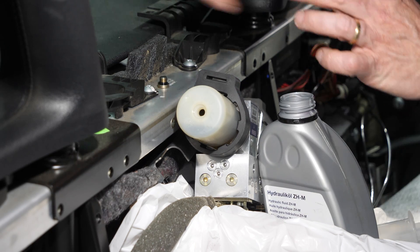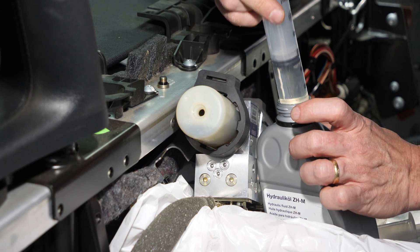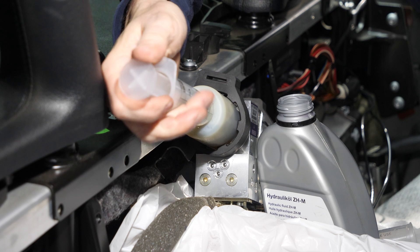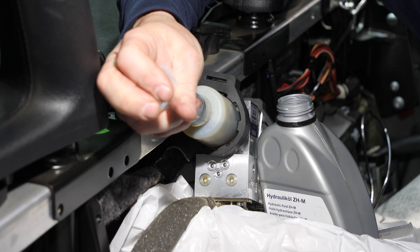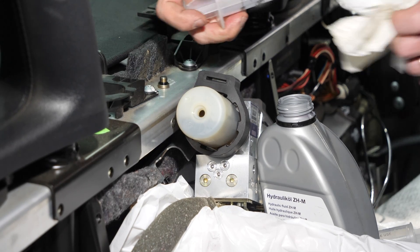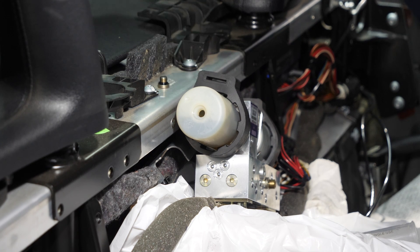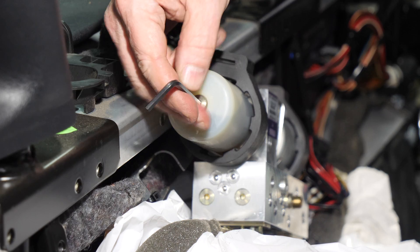I'll stick my syringe into the bottle and suck in some fluid. It's not going to take a whole lot here, so I'm fine with an ounce or so. I start squirting it in — my guess is that I need to fill this to about the level of the bottom of the bolt, and at that point we have enough fluid in there. Let me put the bottle of fluid down so I don't spill anything, then put the fill bolt back in. 4mm Allen wrench — close it. There's an O-ring on that bolt.